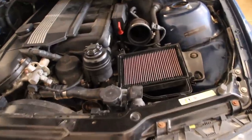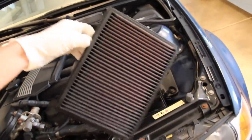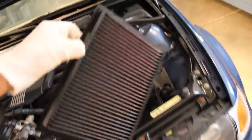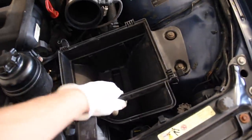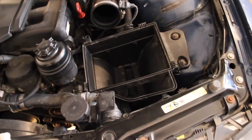The airbox lid comes off revealing your air filter — inspect it. If it's not clean like this one, clean it and/or replace it. This one has a K&N; if it's original BMW it's probably paper. Now that's out of the way, I don't know that we need to remove the lower box, but just for the sake of having some room, I'm going to go ahead and do that.